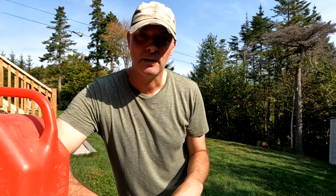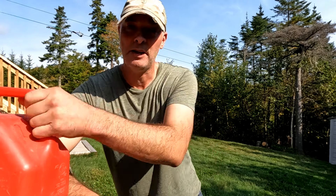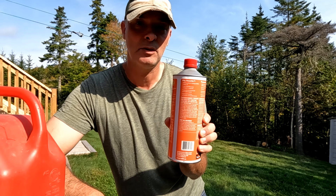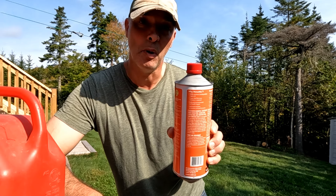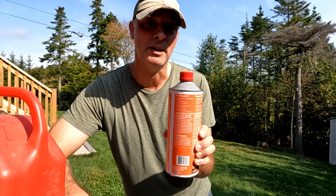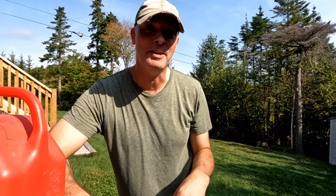Anyway, that's a lot of talking, but I'm hoping this will save some people a few bucks and make the process more simple. Buy high octane fuel, put fuel stabilizer in it at the right ratio, then put it in one of these small containers and add the two-cycle oil. Then you've got your mixed fuel for your chainsaw — it's not costing you $13 a liter, but it's high octane stabilized fuel that keeps things clean, removes carbon deposits, and should keep your small engine running in tip-top shape. Just a little video on chainsaw fuel — I hope you found this interesting. Please like, share, subscribe, and until next time, get out there and get at it.